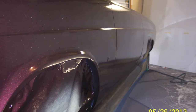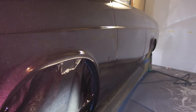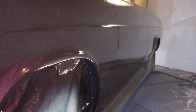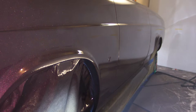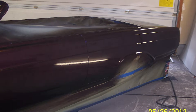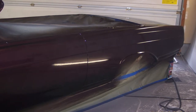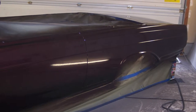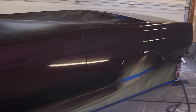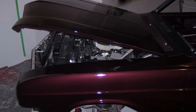As you can see from the pictures, there's a real good high gloss with that deep, rich coat I was after. Along the bottom of the car from the belt line down, just before the clear coat I went back in and misted it with a mixture of about 25% dark gray metallic and clear — probably three, maybe four coats of blending. I went fairly high with the first coat, then a little lower with each subsequent coat, until the fourth coat where I was just really misting the lower end of the car.